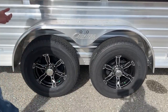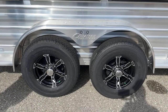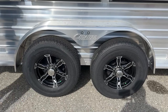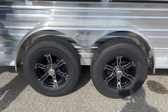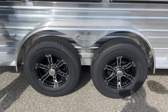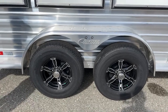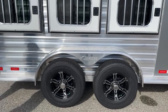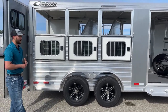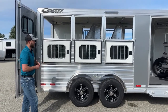All our tires on our Cimarrons and Logan Coaches are coming from the factory nitrogen-filled. Being nitrogen-filled really helps balance out that PSI. If you have cold mornings and warm afternoons — like when you're in your 30s and 40s in the morning and jumping up to 60s and 70s in the afternoon — you're not going to have to worry about dumping air out of these tires or adding air when the temperature changes. It's really going to help balance that out and add to the life of these tires.